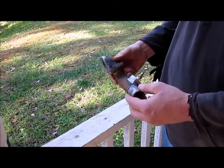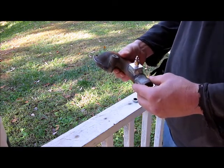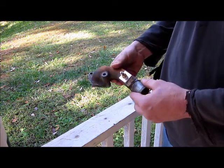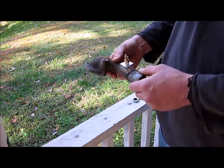So if you want to add an additional coolant sensor or a gauge in your car and still have your original gauge or idiot light, you can tap into your thermostat housing with an additional sensor, and you won't interfere with any of your factory gauges or sensors.